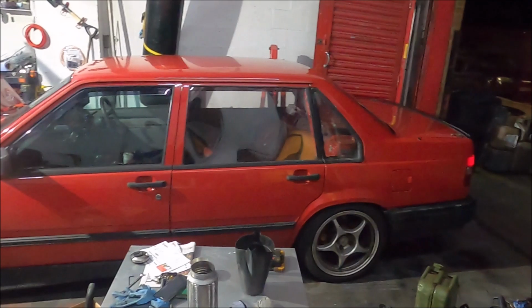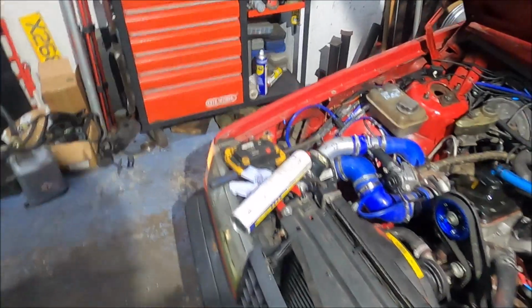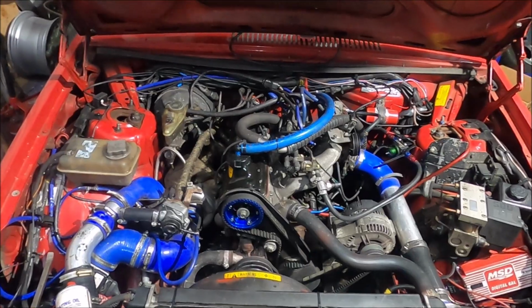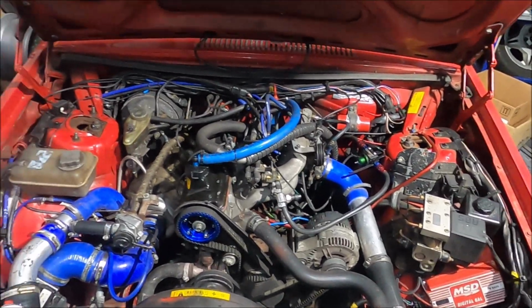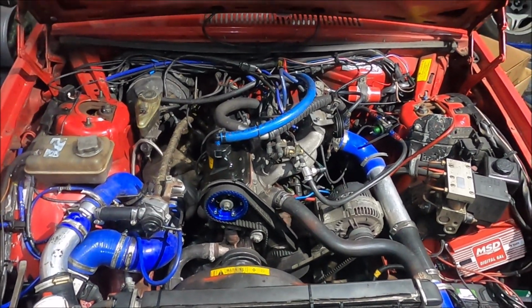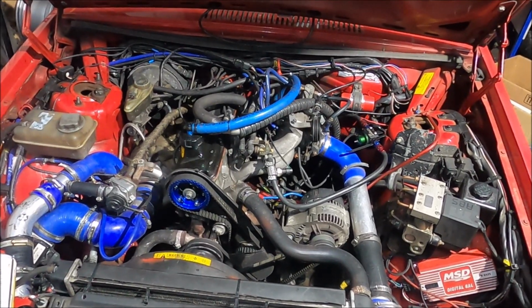As I've had to daily drive the Volvo today, I decided to make the most of that and do a bit of work on it. Not like, you know, actual maintenance or sensible stuff, but mess with the performance again. Basically, if you remember recent videos, I had to up the fuel in a bit because it was running lean top end. But I'm fairly certain that was because the cam timing was quite retarded, and obviously with more retarded cam timing, it is generally more top end flow, which is why it's running out of fuel. But obviously it's give and take, and it loses a bit low down.